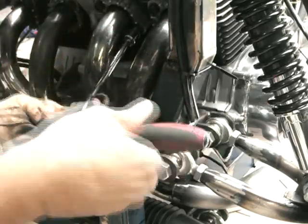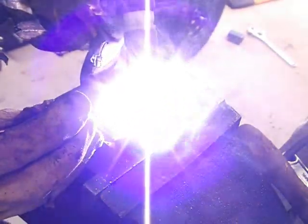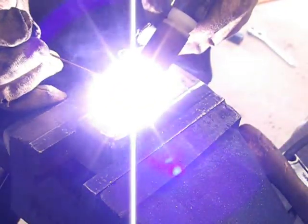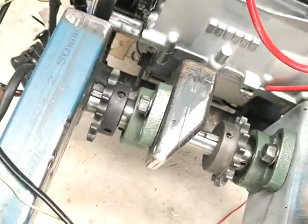The other thing I did is I've built a jack shaft. I wasn't sure what design I was going to do but in the end I've made it so it goes from the motorbike engine to a one inch shaft, and then a second sprocket is going to go from the front out to the back gearbox, which is pretty much the next job. I just welded a nut in here so I could bolt it in properly, and I've got adjustment through adjustable bearings. It's mega strong so this jack shaft isn't going to break any time soon. Engine to the sprocket on the left there, and then the second sprocket will drive the gearbox. Stay tuned.